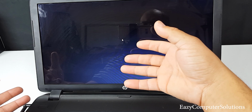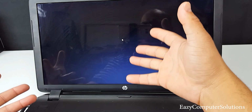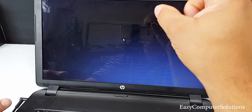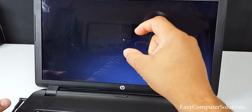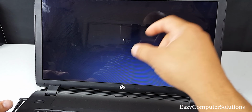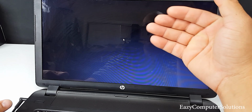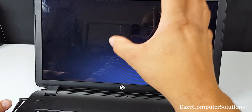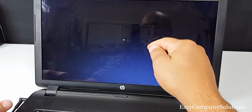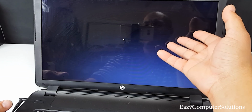This type of stuff happens a lot, but I'm going to let it boot up because you can get into it. I've had videos on my YouTube channel about how, if you can't boot up a PC, you can go straight into safe mode or hit F7, F8, or F9 and get into the boot up process. But I'm going to let it boot up, and I'm going to show you, if you can get inside the PC, a real quick, easy way to do a factory reset and get it out of the way.